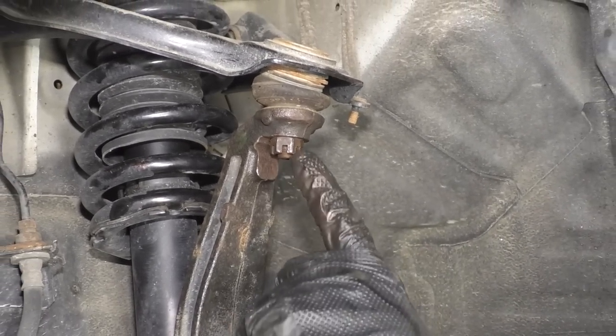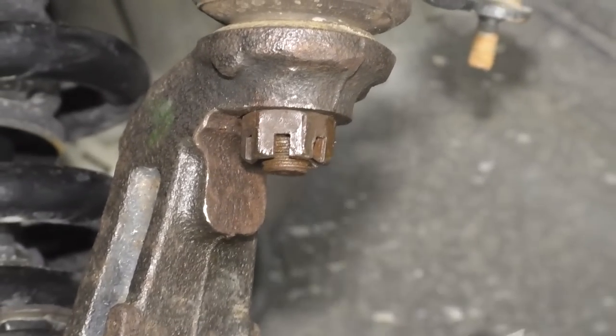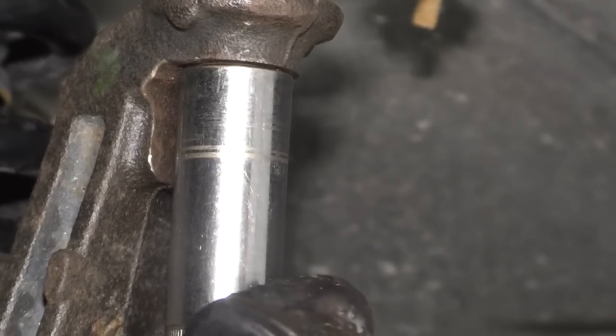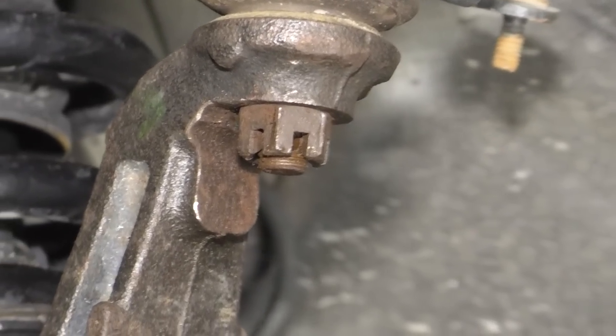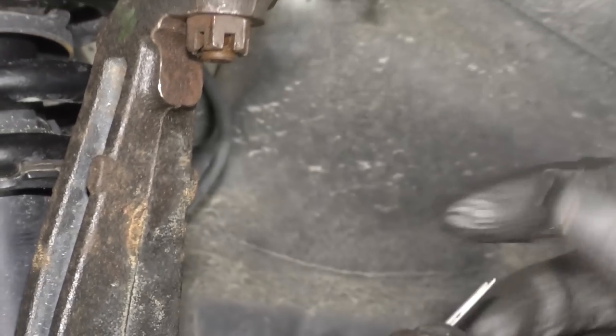Okay. So, looks like we're just past the hole, which is kind of a bummer, but it's okay. I'm just gonna bring it, like I said, to the very next hole. Torque wrench is barking at me. It's okay. Here we are. Now I'm gonna put my cotter pin through. Brand new. A little bit of goo on it.